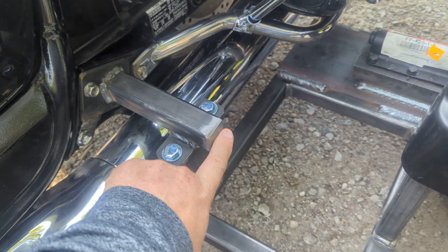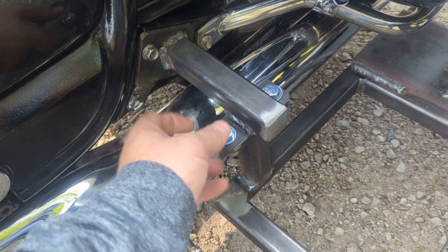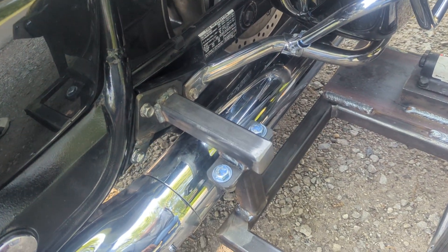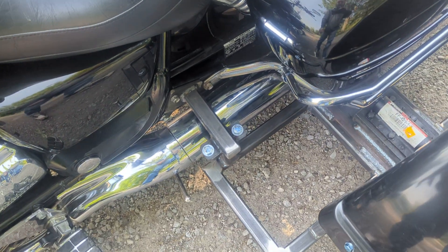On this one here, the foot pegs needed to be a little bit longer, so instead of hooking at the end, we decided to make it where it bolts up into the frame like this. As you can see, solid as can be. You just unbolt these two bolts on both ends, and then the back end where it normally bolts up, you unbolt that and it'll come right out from under it — you don't have to take it apart.